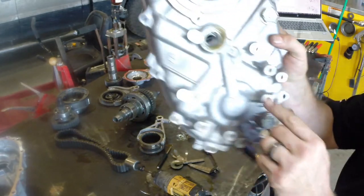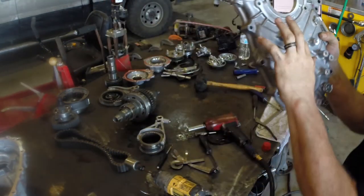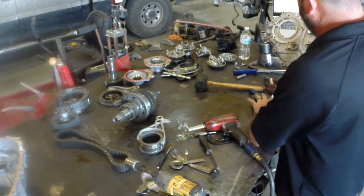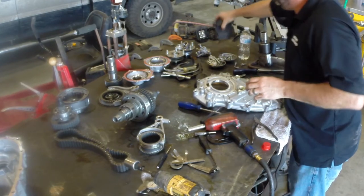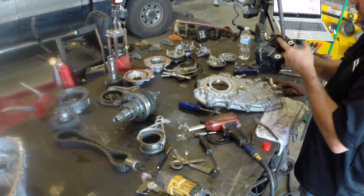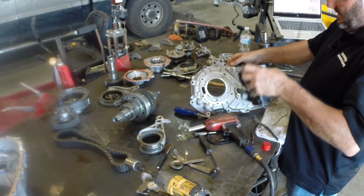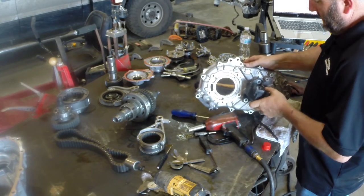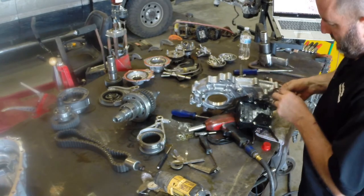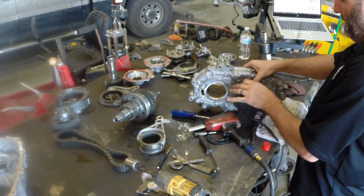The factory had grease on the O-ring so it went in without damaging it — that's a good idea. If I had put everything in the parts washer, we'd definitely put new grease on a new O-ring. In this case I didn't clean it, so it's going back together with the factory grease. The factory Toyota grease is probably better than what I have here anyway.